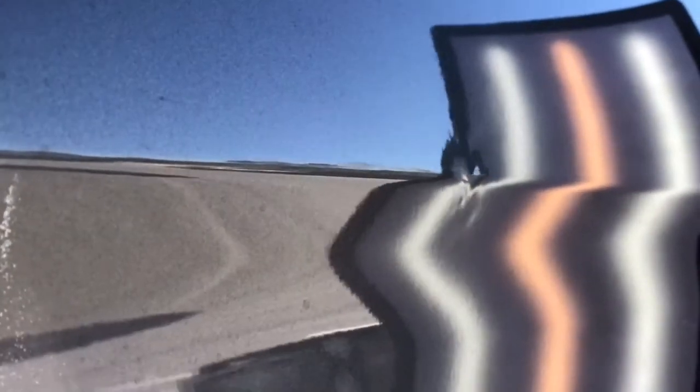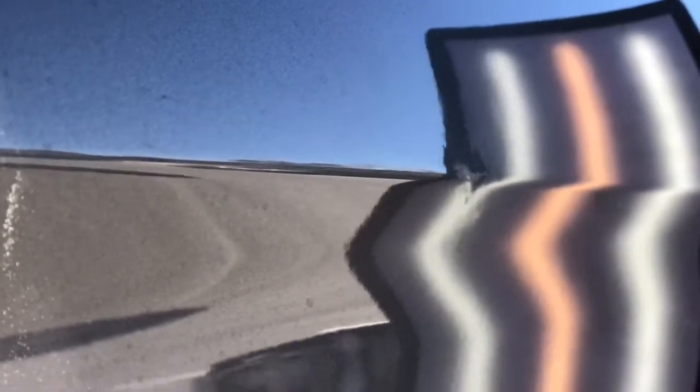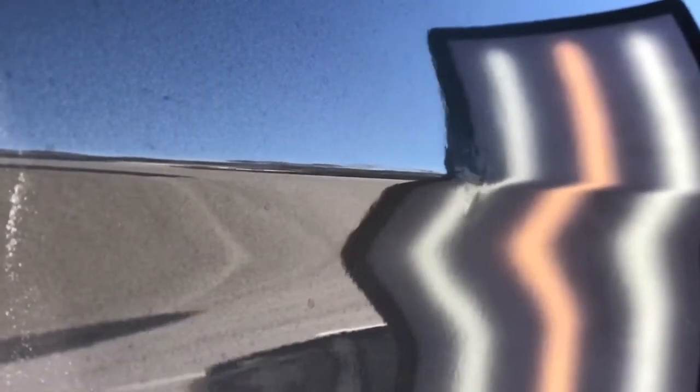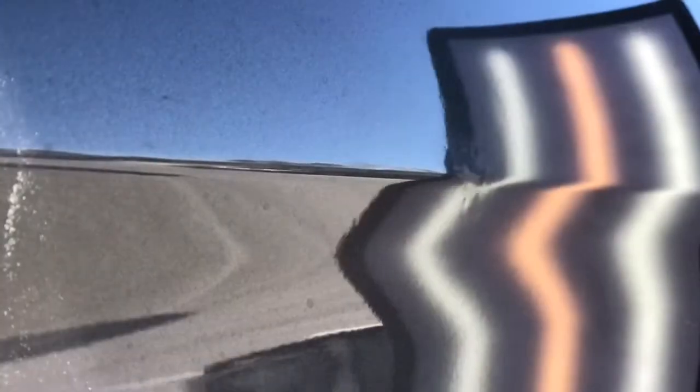So what we were doing there was knocking those crowns down — that's trapped pressure holding the dent in. We have to contend with those before we start pushing out the damage. It may be too quick for you to see, but we actually had to heat this dent with a torch repeatedly to keep the paint intact and keep it from wanting to crack.